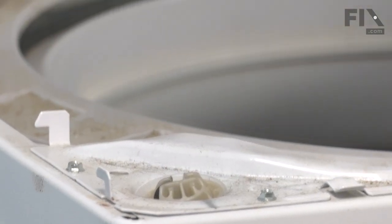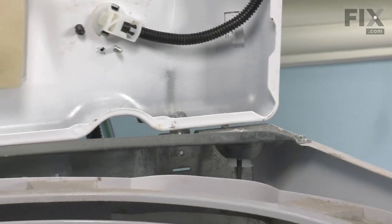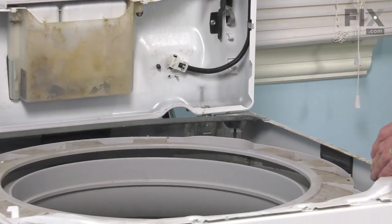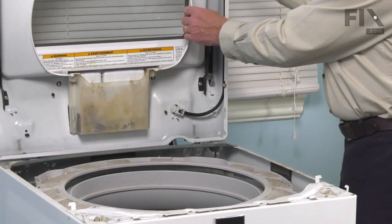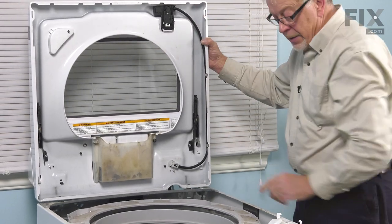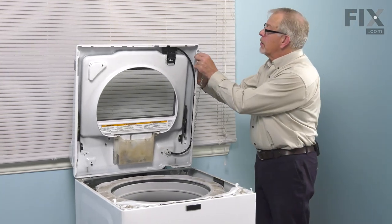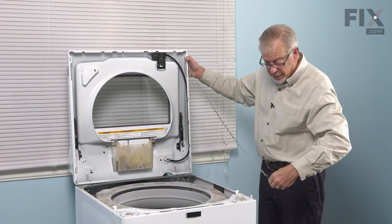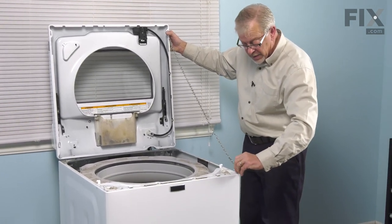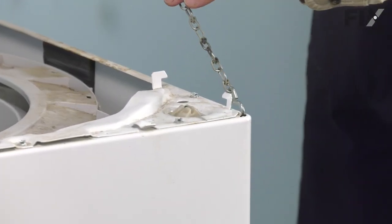As we raise it up, just take note in the back — we want to make sure that the two slotted openings on the back of that main top fit down over those two tabs that we took the retaining screws out of. That will keep the base of that main top from sliding around. Next, we either need to have somebody support that while you're doing the repair, or hook up some type of lanyard that we can attach to the top and to the cabinet. We've taken a short length of chain, we're going to put that slotted end on the top and secure it at the front of the cabinet. That will keep that securely in place.